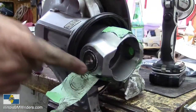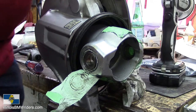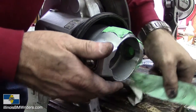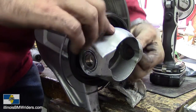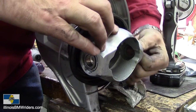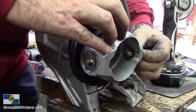In order to get this bearing out of here, you've got to drive it out. Let's take this all the way off. Usually it's only the one side that goes bad. I don't think it's really all that necessary to change these in pairs. This one is a little notchy but I'd let this one go.